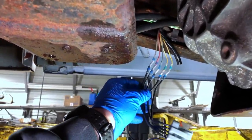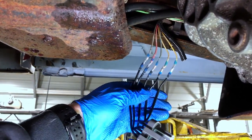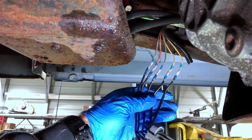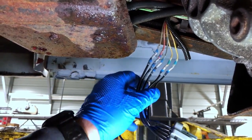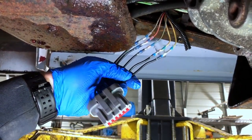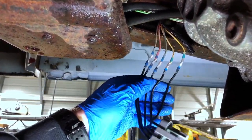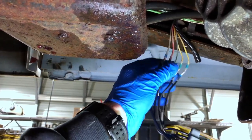True to my word, I'm back now that it's all installed. I was pretty happy with the way these worked. However, doing them vertically like I did, heated them just like this, the solder obviously wanted to follow gravity and go down. I think they would work better if I had the room to do it sideways, but all in all they worked. I'm pretty happy with them — easier than butt connectors, and they say they're waterproof, so I guess we'll find out.